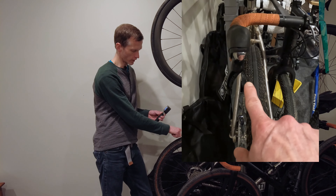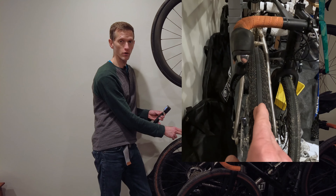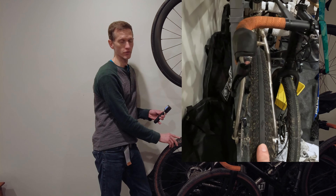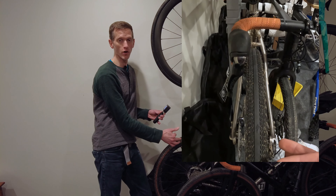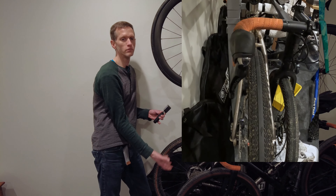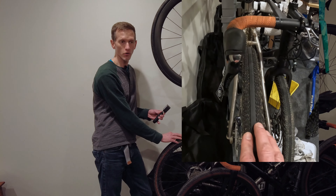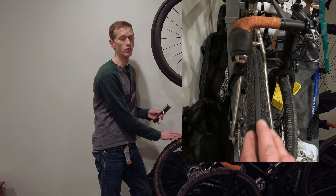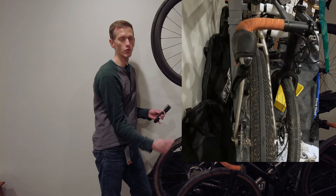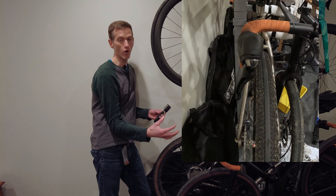But for me, the biggest con for these tires is that you need to be really careful about how you set them up for the surface you're going to run on. You can see there's a slick center channel, and you can see it has a very pronounced rounded profile. That makes this slick center channel hit the road very prominently — that's part of why these tires are as fast as they are, especially on hard surfaces. You're basically riding a slick if you're on a hard surface. If you're running on a wet or muddy surface, you'd let air out to flatten the profile a little bit so the lugs engage more quickly.